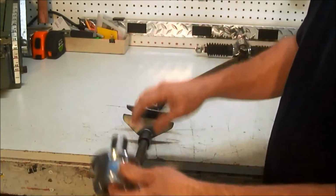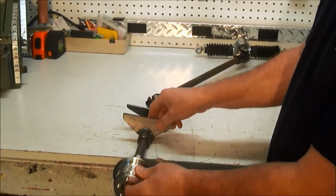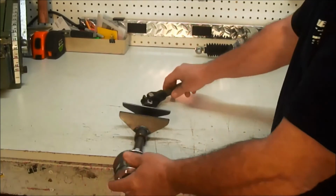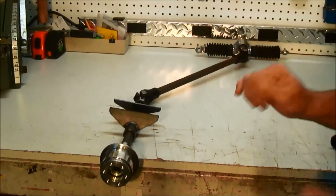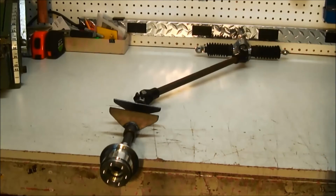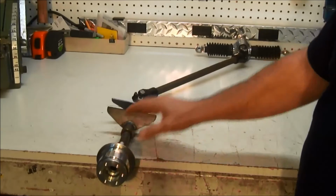And then you just take a steering wheel disconnect and you figure out the right length you need on the shaft, and you cut it, weld it, and that'll get you from the windshield bar to your steering wheel and get you the right distance that you'll need. And at that point you have a complete unit going from the rack up to the driver's side.